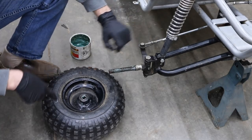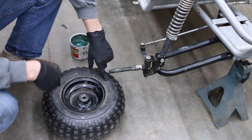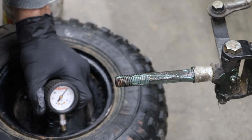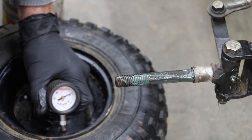It really doesn't matter how much suspension you have — if your tires are over-inflated, you're going to have a rough ride. The max operating pressure is 3.6 psi. The current pressure is 10 pounds, so it's got way more pressure than it should have. I'm going to lower the pressure down to about three and a half pounds.